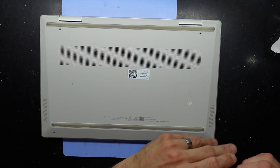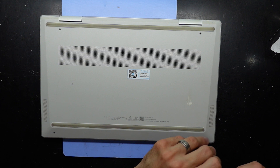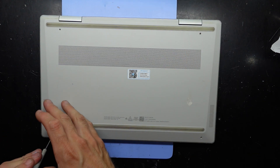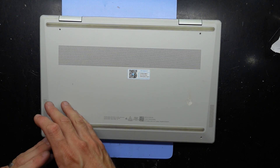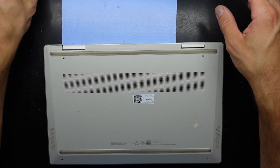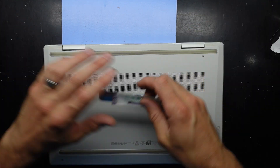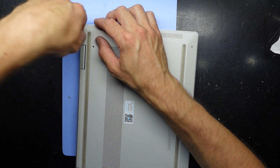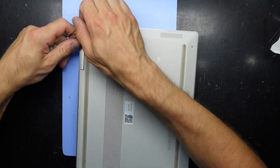Even if your machine's producing an error message saying 'CPU fan not spinning,' more than likely it'll have to be replaced. This one was doing that up until a minute ago, and now I can't seem to get that error message to come back, which makes me think that there's something clogging the fan — it wasn't able to spin before, but yet it can spin now.